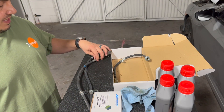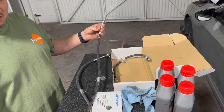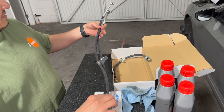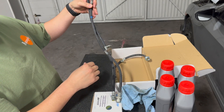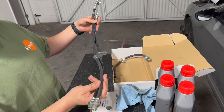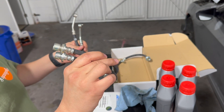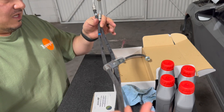We just took off the FL5's passenger rear brake line and we're going to give it a comparison against the OEM FK8 brake line. There is a difference — the mounting point is different, and the length is going to be different. It's slightly longer, by about an inch and a half to two inches. The flares where the hard line goes in are pretty much the same, but there's a big difference in length for the rear ones. The front ones were a little less obvious, but the rear ones are totally obvious.